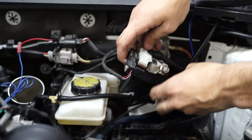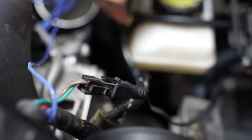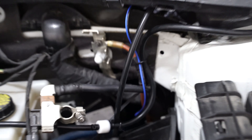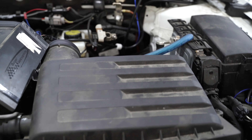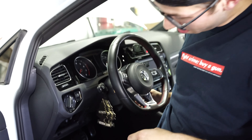This is the factory vacuum line that comes off your car — you connect that to the T-valve. This is the source, so you connect the source to the front of the T-valve, and then you connect this cable to the one-way. You want the white side facing towards the T-valve, and the black side connects into the front, and then the top side goes down to the exhaust. Once I have the battery back in, it should work. We're going to go ahead and put the battery back in, start her up. We put the OBD2 dongle into the splitter — I got a splitter because I have a JB4 as well.